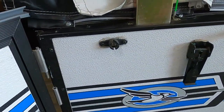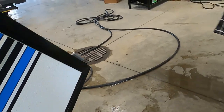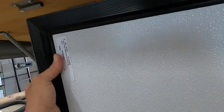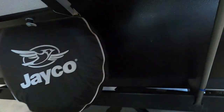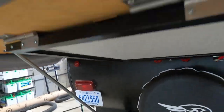Take this door and lift it right off the hinges. Come to the back of your trailer here — make sure you have the snap down. Take this, hook it right up here, put both hinges in there, and once you've got them in, bring this up, snap that on, and that's going to hold your half-door while you bring down your full door.